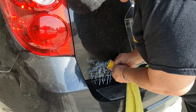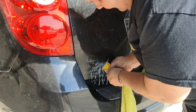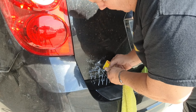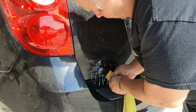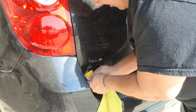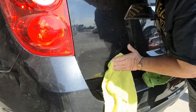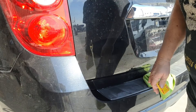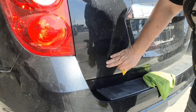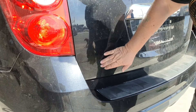The bug and tar remover has an adhesive buster in it and it allows you to take that rubber off — it allows you to take the adhesive off. And that's it. Just use some bug and tar remover to remove that rubber that's left behind and the sticky stuff. If you have sticky stuff it'll leave that behind, but you should be good to go.